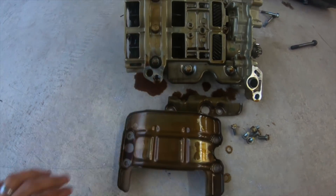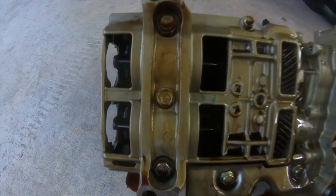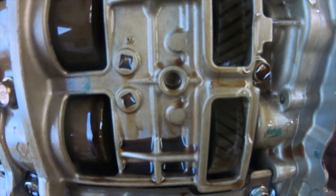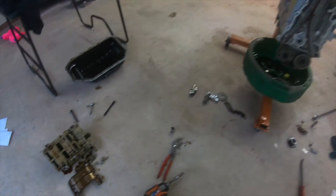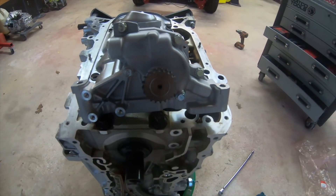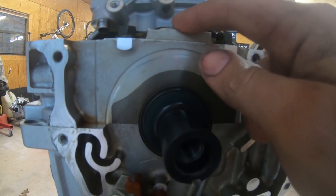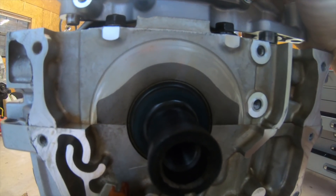Old pump, new pump. Never taking this ugly looking oil pump out, which is the K24. See the weights on that? It's also heavier - see how big that is. Compare that to this Type S pump, which by the way comes with a shield and the bolts. In order to make this oil pump fit you have to shave it - this piece on the block is in the way. If you line it up you can tell exactly what it hits, so you gotta cut right there.